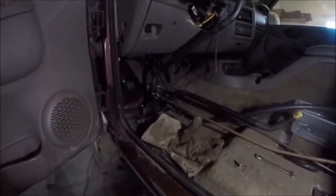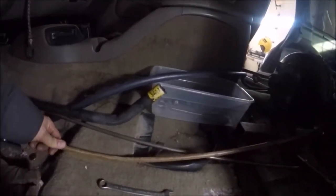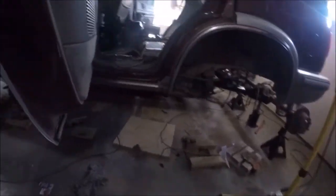This is my first attempt at the brake actuator bar. I upsized to half inch and built a little bracket that fits right in the hole. I went to a half inch bar since I had some instead of three-eighths, but there's still a lot of flex in the bar. I built a little adjustable end with a piece of three-eighths and a nut, but forgot it has a pivot, so it bent the bolt.